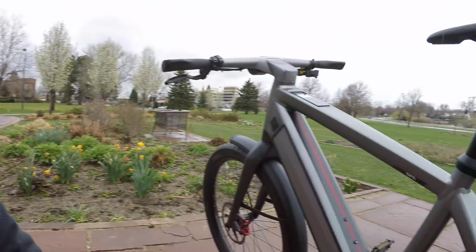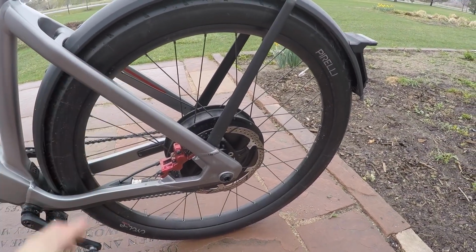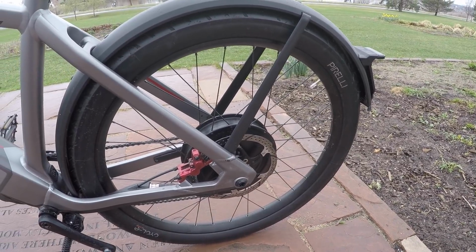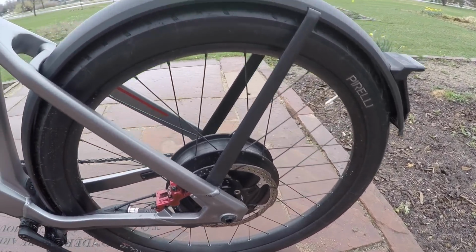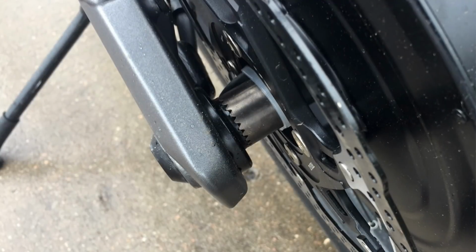So you come back to, okay, those batteries weighed 5 or 6 pounds. This one weighs 9.8 pounds. I guess I understand that. And then back here with the motor, this is like a 700 or 800 watt, depending on how you measure it or what geography you're in. It's from TDCM, it's gearless, direct drive, and you can actually see there are these teeth in there. You see those? That's where it's pushing.